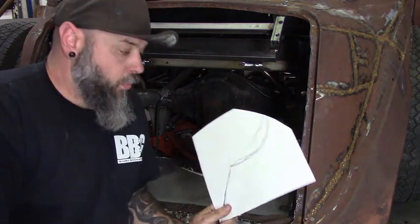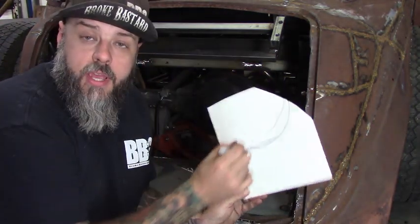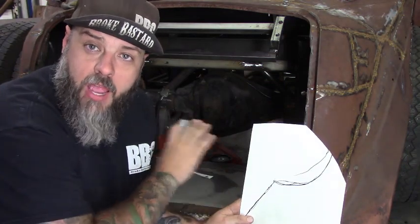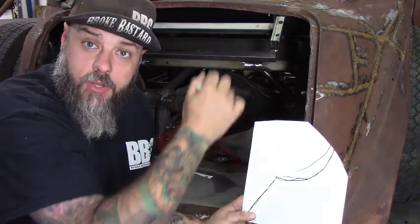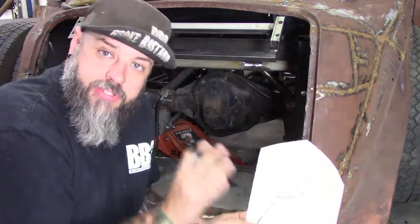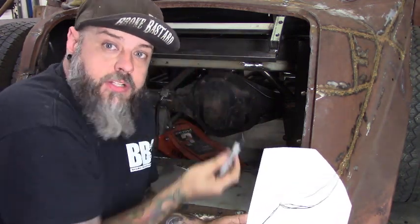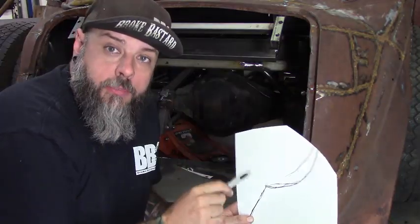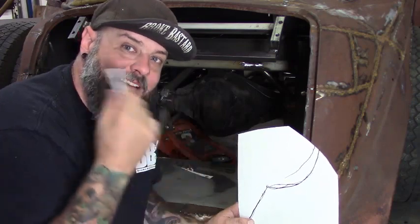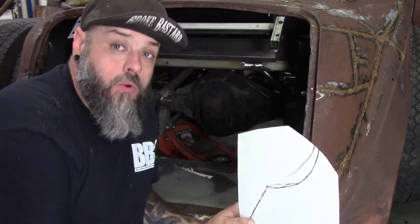I've gotten a side profile of the straight area to curve around the tank using posterboard. We're going to start with a flat piece of sheet metal, go all the way across, and try to roll this curve onto it, checking against the profile as we go. There's framing up above past the tank, so we've got to wrap all around it and tie into that framing, then come down and tie to the frame rails. I've never had great luck with my roller getting adjusted right, so we'll give it a shot today.